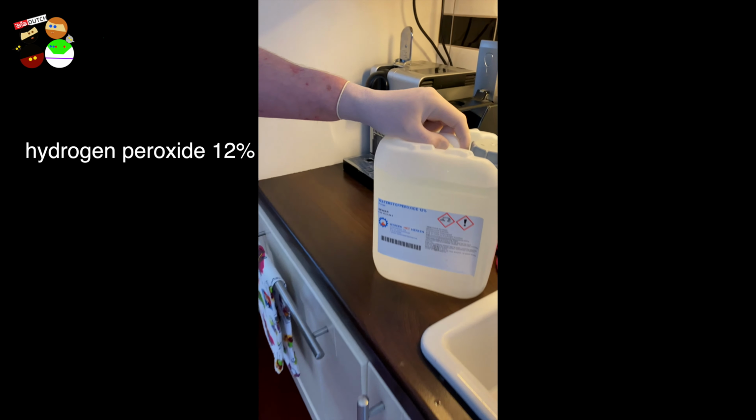It's so crazy because we saw so many people online doing it. Some end up with nice results, some end up with no results at all. It's important that if you use this technique, you don't make it too hot, because at 70 degrees Celsius, your plastic will melt. So that's not a good idea. So what's the right temperature in this case? For these little knobs, I was told 50. 50 degrees. So it's almost there. Okay, and then you put them in there for 2 hours.